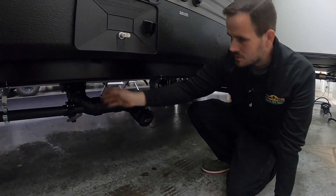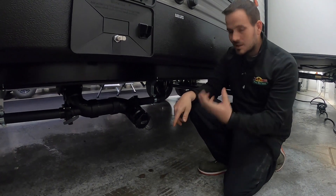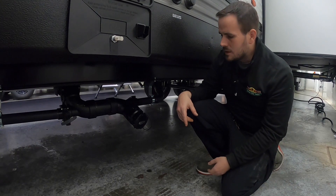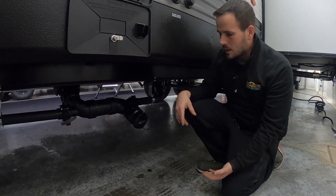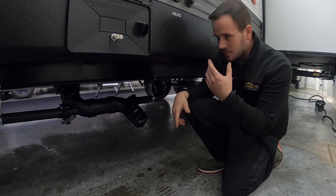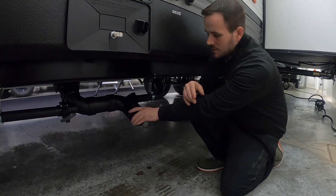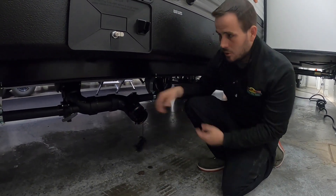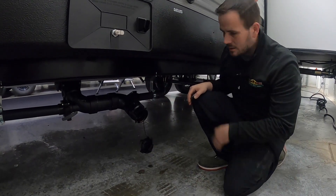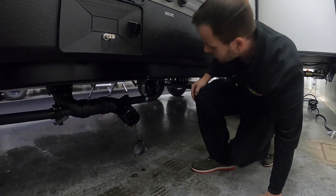One thing you can do — we get a lot of calls on sensors always reading two-thirds, which is very common in the RV industry. One thing you can do after you get home, if you've done the sewer flush and chemicals and you're still having that issue, leave the cap off and when you get home, open the black tank up and let some air flow in there overnight or a couple of days. Sometimes that'll help dry out the probes and make your reading go back to normal.